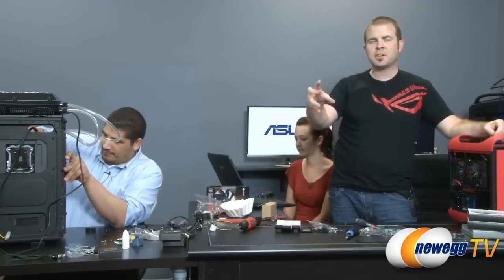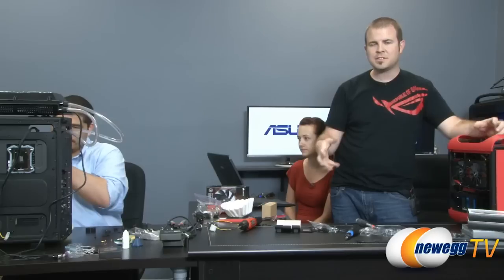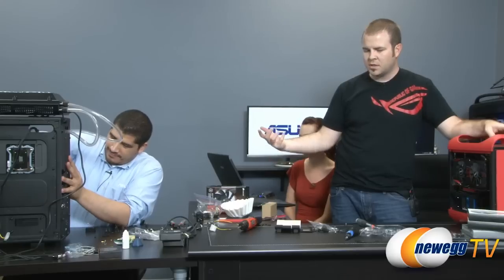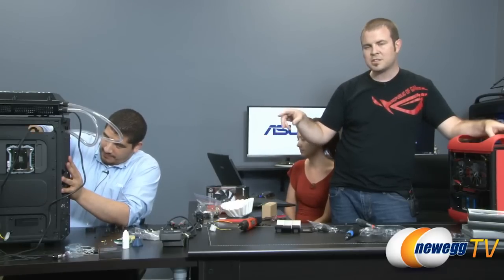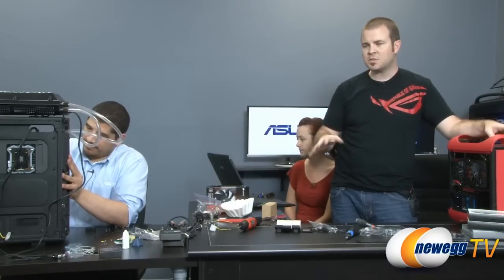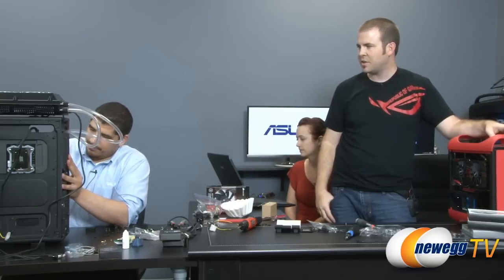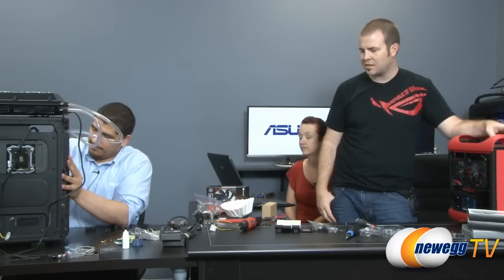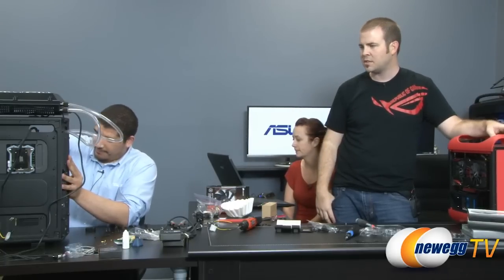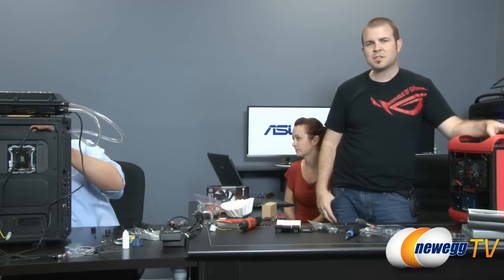I actually grabbed all of the 4770Ks that we currently had here in the office because I wanted to bin them and see which ones performed better than others. I used the Z87 Pro and the 4-way optimization, specifically the TPU function, to automatically overclock each chip to get a quick approximation of what each one was capable of achieving. We actually got a really good batch. They were all hitting 4.6 to 4.8. I had 2 that did 4.8 on 2 cores at least. Cherry! So yeah, pretty stoked on that one.